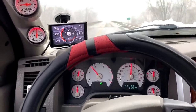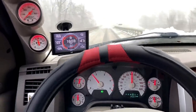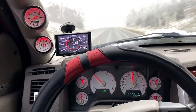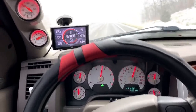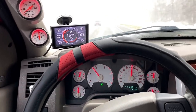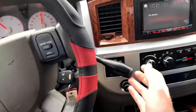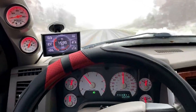See, it'll just hold on to this gear no matter what — unless it's completely floored, it'll downshift, but that's about the only time. Alright guys, we're going to get it to downshift here but I'm going to have to floor it. It's snowing and just above freezing right now, so the roads are going to start to get iced up — you can see there's just no traction. So you're better off to hit the tow haul button and just ease into the throttle and it'll downshift itself.